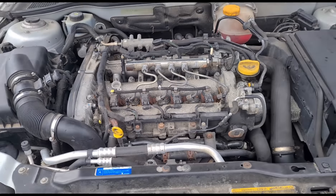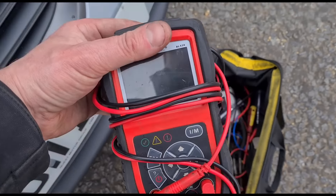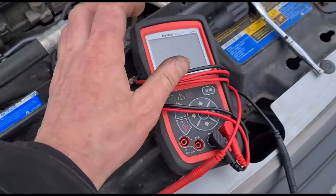We've got a couple of tools here ready — a pliers, a glow plug socket with a swivel on it, and a magnetic grabber. I'm going to get these plugs off, so we need to be gentle with them, get a bit of leverage, and pull all four of them up. We'll give them all a spray with this from Launch UK to help if they do need to come out, then use this tester to do a continuity test first. If that doesn't work we can do other tests to confirm if there's an issue with the glow plugs.